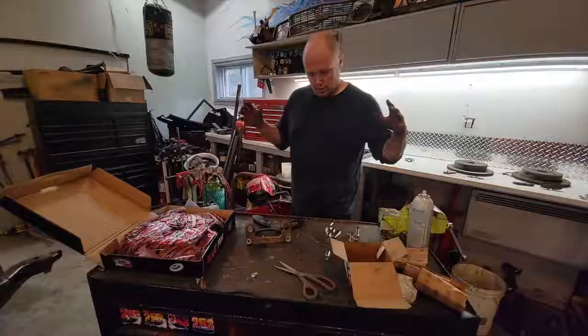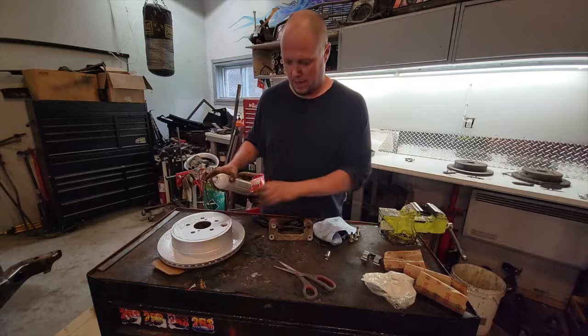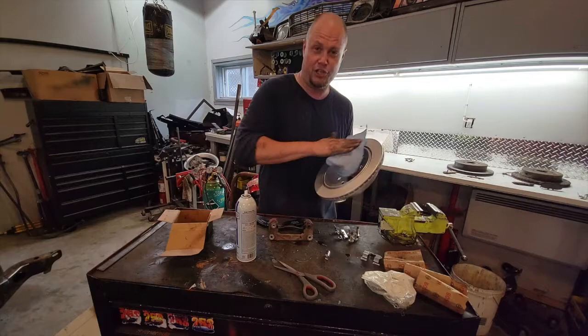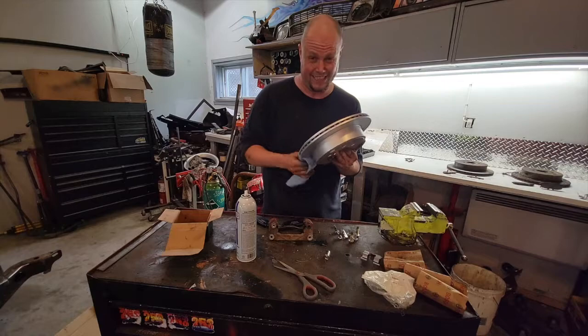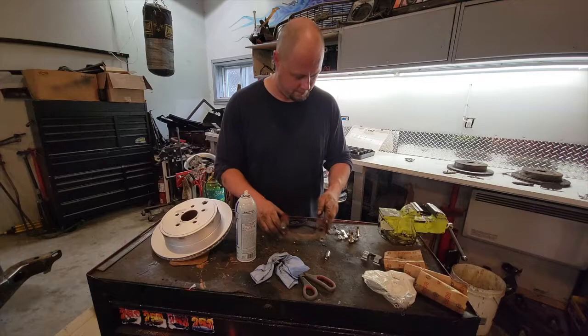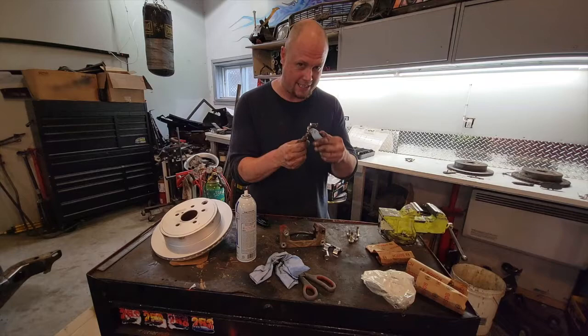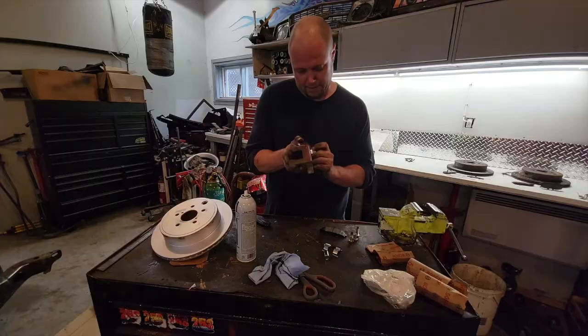We're going to prepare to put the new setup in. I want to give these a quick spray with some brake cleaner — we got the 313 clean flow. The idea is to clean off any rust repellent they might have on these discs, because I think it might get gummy in your brake pads. Just to make sure we're good, clean, and safe. My dirty hands ruin the clean look of the rotor, but what do you want to do? Next up we've got these fancy deals — we're going to put our new pins in here. The new pads are going to slide on these, so you've got to make sure they're nice and clean. That's why they always give you new ones. As far as I know, you just jam these in by hand — the long part goes down towards the bottom and you squeeze them into their spot.